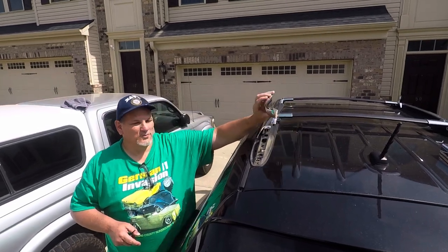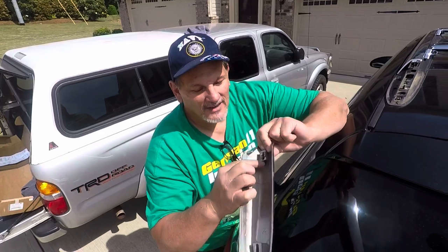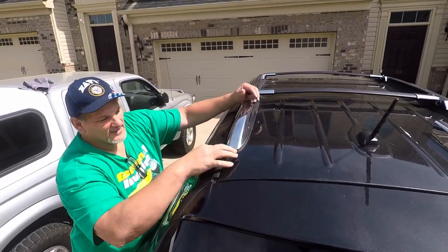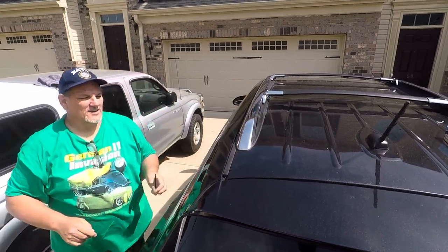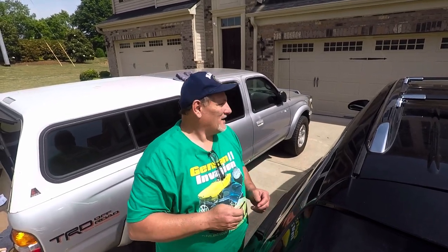The back bar is now installed. All that's left is to replace the end pieces for the clamps. You have tabs that line up with the little tabs on the rail, so fit it down, line up the gasket that goes around the car, and slide it forward — it'll snap right in. Once you're done, put the tool in your glove box so you have it accessible for future adjustments. Check your bolts periodically in case anything comes loose after or during a trip. Thanks for checking out the channel — I hope this helps somebody. Give a thumbs up, like and subscribe, and plenty of other things are coming. Y'all have a good day!